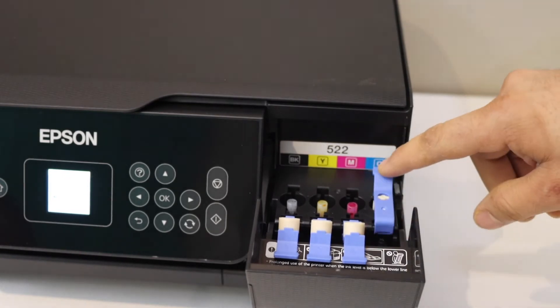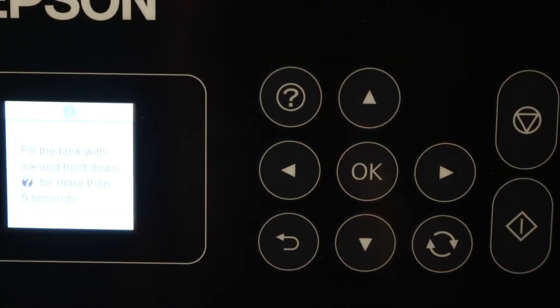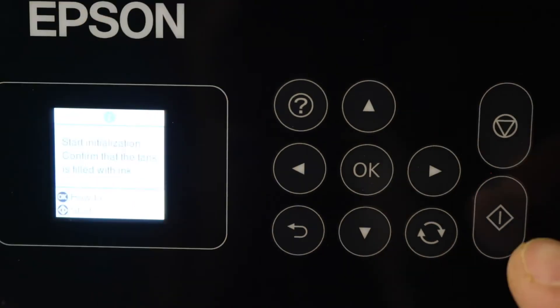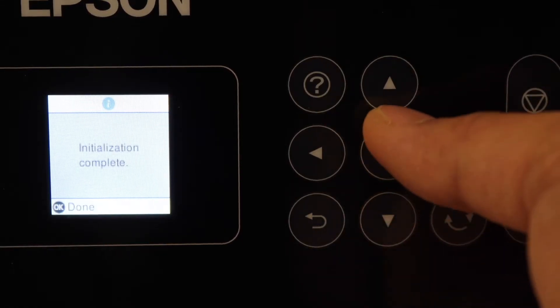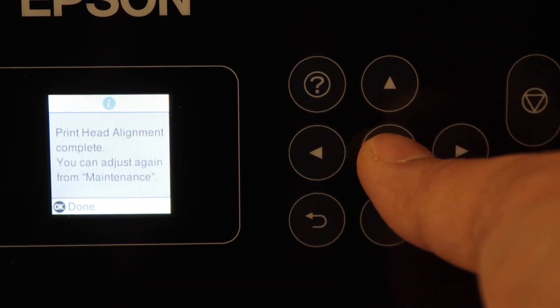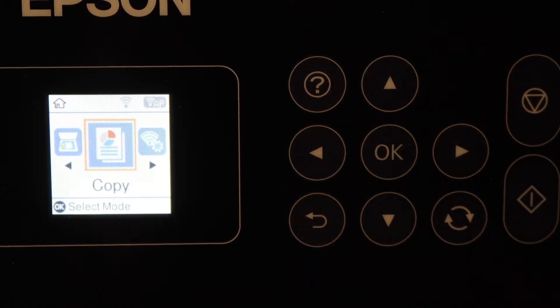Close this seal, go to the printer screen, and press and hold the question button for five seconds. Click on the start button. Once it is complete, click Done. You can adjust the print head now or do it later, and once you do that you will see the main screen and the printer is ready for copy.